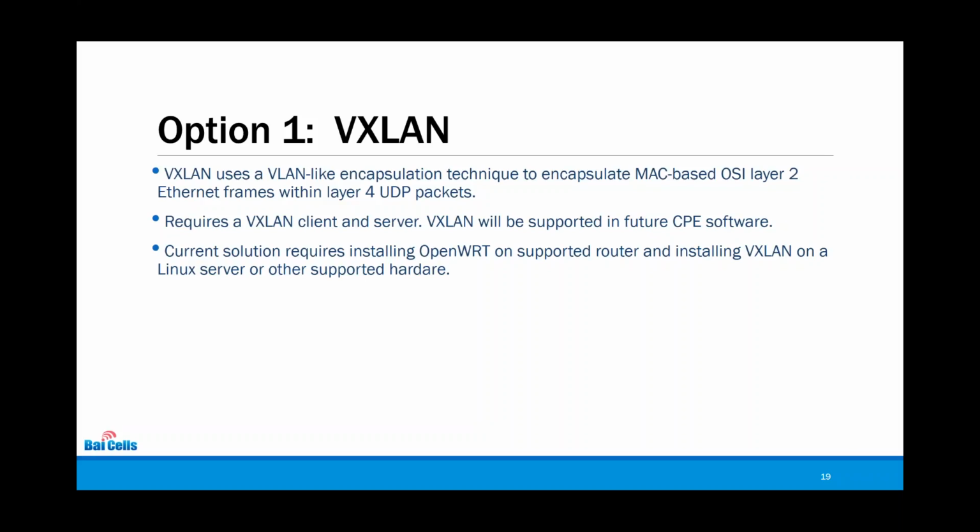We have plans to implement VXLAN support in future CPE software. So for anyone that does this in the future, it's going to be a lot easier. Currently, if you want to do this option, the subscriber would have to install this on their router, which the operator would most likely do for them using OpenWRT. OpenWRT is the only software we know that can natively support VXLAN. So at least for the operators we've tested this with, we would install OpenWRT on the customer's router. And then you need a VXLAN server, so you just put that in your NOC somewhere on a Linux server.